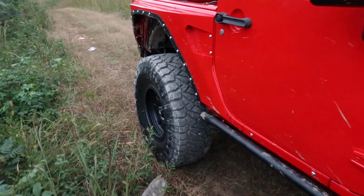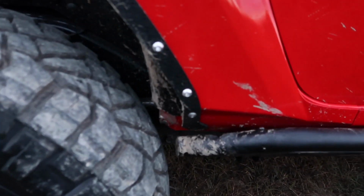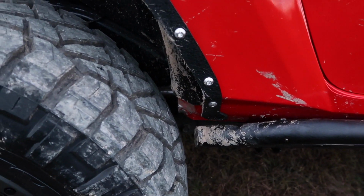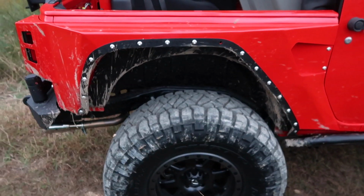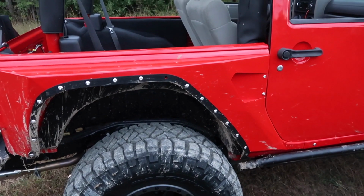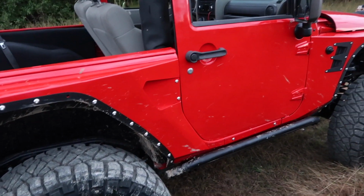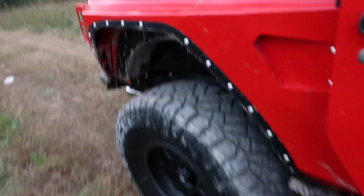aligning our rear axle. We're gonna push that back just a little because you can see how much closer it is to this side, and we have plenty of adjustments. So we're gonna go ahead and adjust our axle and move that back some. But overall the Jeep came together great, and we also got a little bit of mud on it, so it performs off-road just as well.